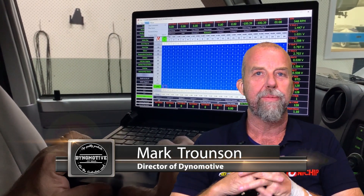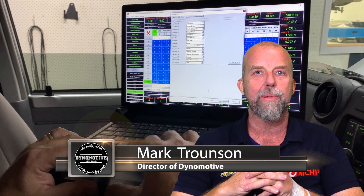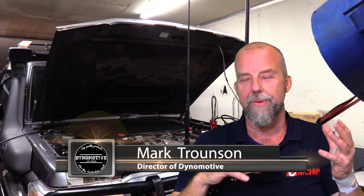These 70 series are fairly simple in their fueling — there's no long and short term fuel trims. There's no real active correction; they've got oxygen sensors but they're very hit and miss from the factory, so blending those in is very simple. It's a matter of chasing the maximum number and then blending back from there. There's no point chasing a number in the mid-range and cleaning up part throttles, and then you run it up and find it only makes 20 psi. So we always start with the maximum and then work our way back.